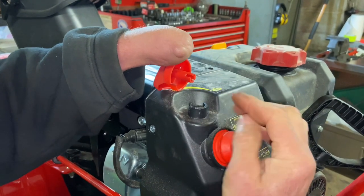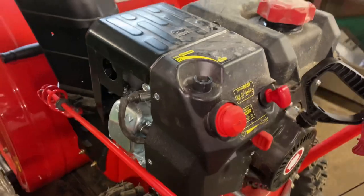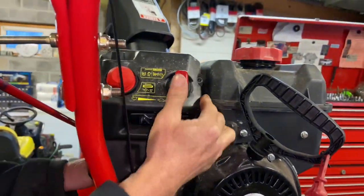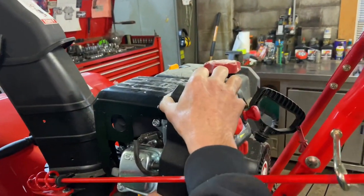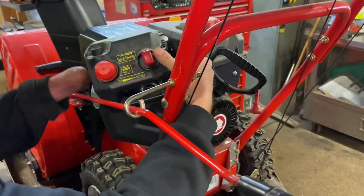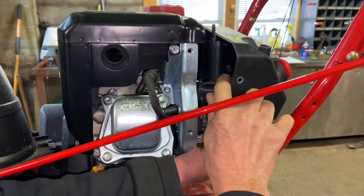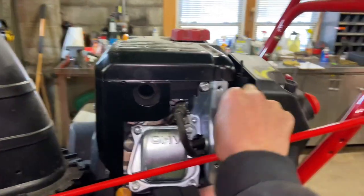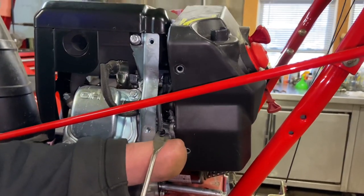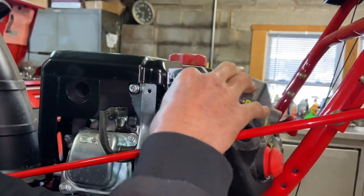On this side you've got to look down inside. There's a little plastic rod that goes down into the carburetor — you just have to make sure that you put it back on correctly. So at this point you've got to make sure you're in the center for your little slice right there and it'll pull out. Because of this plastic rod, you have to kind of push up on it and then off to the side — it's a little tricky because you have to get everything to pull out at the same time. I can already feel the tension on the primer line. The primer line goes from the primer bulb all the way down to this clip here, and I'm going to take it off the bottom where it's connected to the carburetor. Be careful you don't break that plastic inlet — that's plastic.